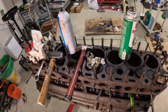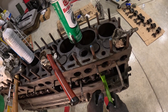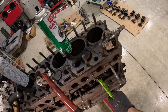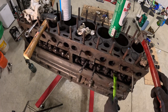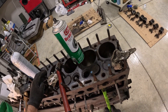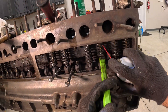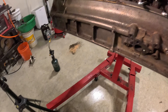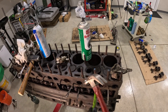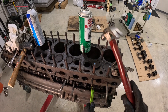Then tapping on the valve with the hammer — you can see how it goes down. I can push it back up and you see the valve lift a little bit easier. I keep doing this, getting the valve moving. Now it's moving a little bit easier. I'm going to hit it with some freeze off up on top and a little bit on the bottom.